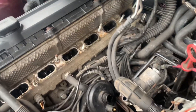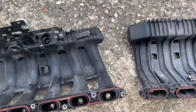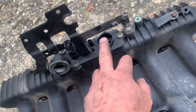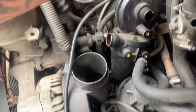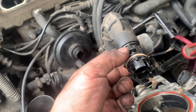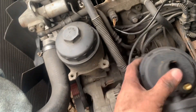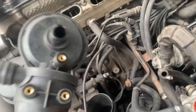Right, we're off. Not too bad — a little bit fiddly. I left the fuel rail on, which probably made it harder work, but not too bad. Underneath there are a few differences. On the stock 328i you've got a breather going in here and another breather going in here. On the M50 you've just got this bit here — it goes up to the inlet off the intake elbow and clips into the M50 manifold. The other breather goes from the rocker cover through this and then down into the sump.